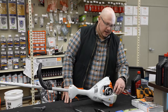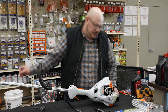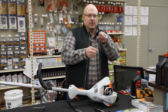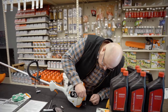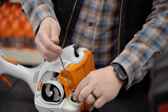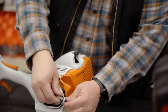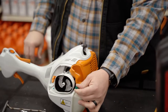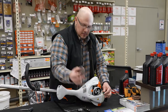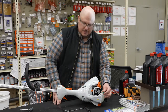The third item is your fuel filter, which on this model is a little bit trickier. If you have a handy little tool similar to this, or a piece of wire that you've put a hook in, you can generally reach down in there and snag your fuel line — not as likely to get this one with your fingers unless you have really long fingers. Grab that and just pop your filter off. There is a service kit available that will come with the air filter, fuel filter, and spark plug for this unit.